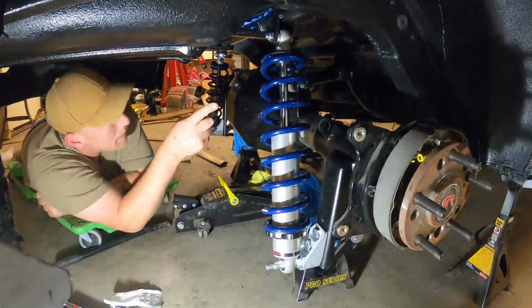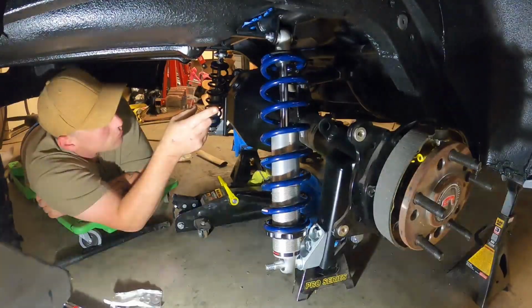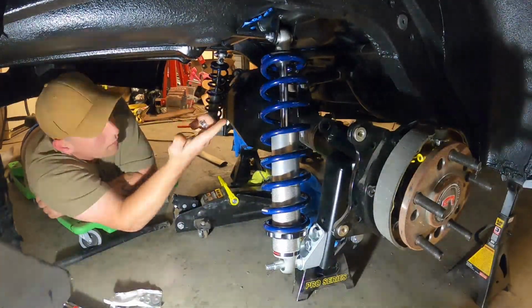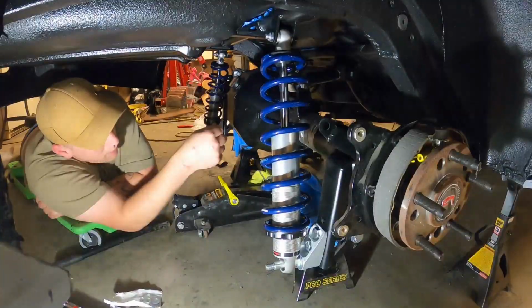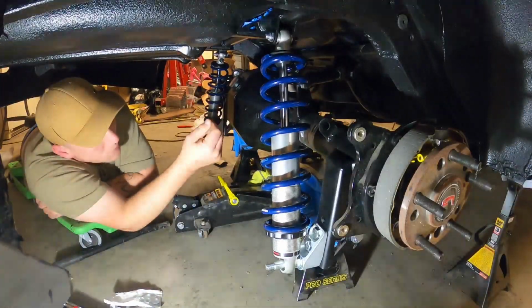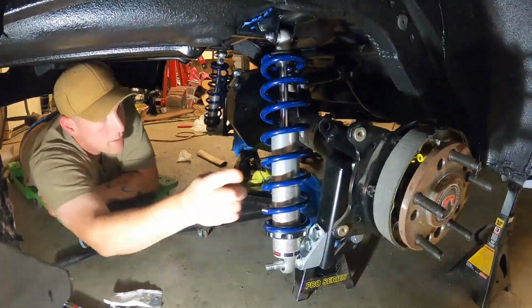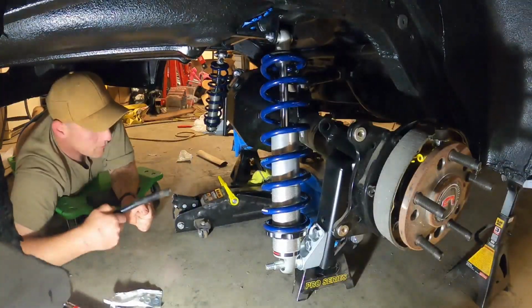And then on these link mounts, I did a whole bunch of researching and I wasn't able to find an actual torque spec on any of them, but most people said they were just torquing them between 60 and 70 foot-pounds, and again, the instructions just say to torque them until the gap is missing. I know on them front ones I think I did 90, so I will probably do 60 to 70 foot-pounds of torque on them and get them torqued up. But first thing first, let's get these shocks back off of here and get the bushings in so we can get this stuff together.